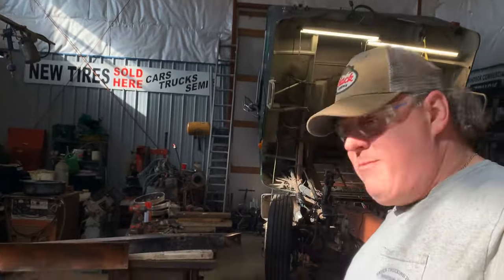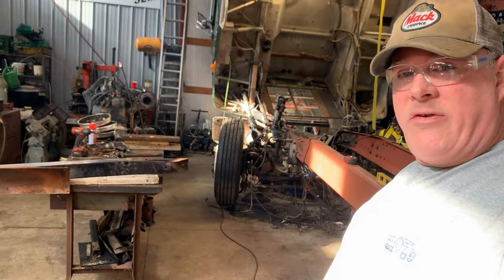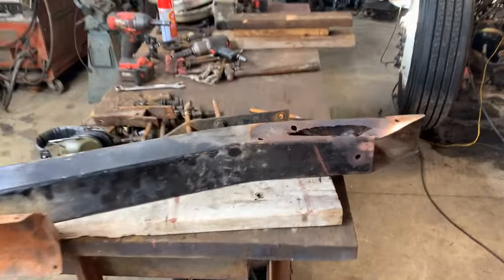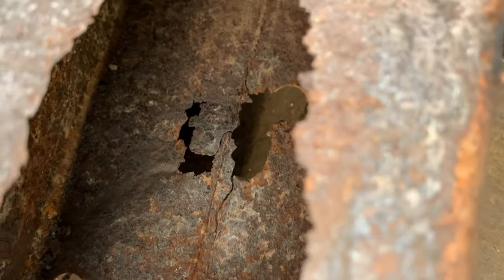We're starting — this is the beginning of the next video. Frame rails are in. Now we've got to get the cab mount and the exhaust mount. The cab mounts down here on the floor are cleaned up, wire wheeled, sandblasted, reworked, primed. Let me show you what we've got to do here — got some problems, just all rotted out. Top and bottom sides are okay.